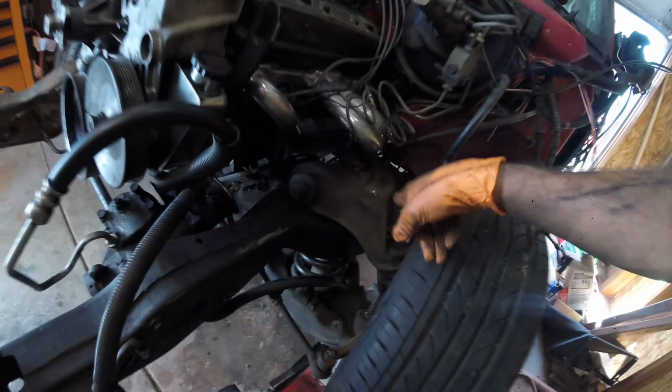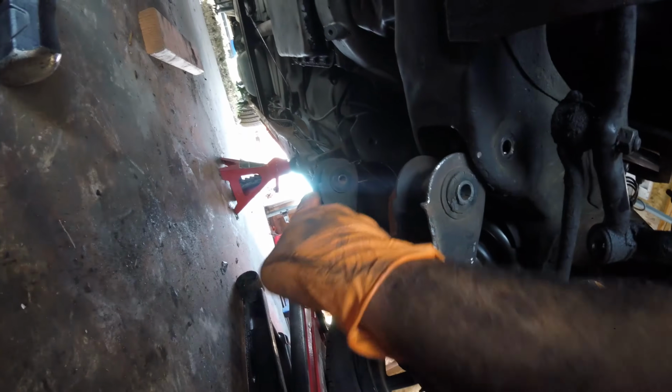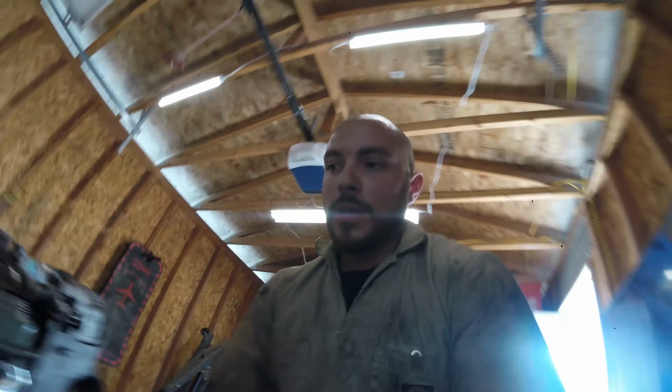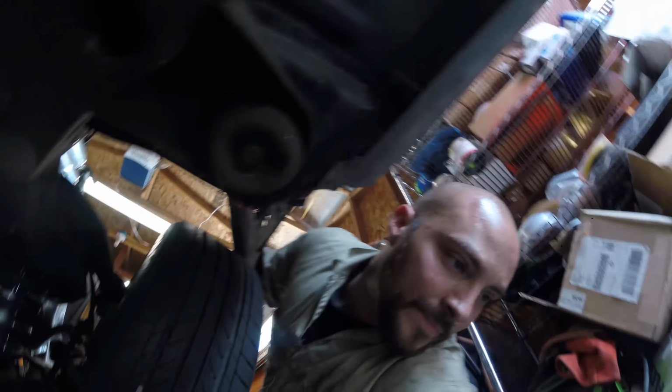Alright, it's closing time. I got the strut in, and then it uses a double nut feature. I'll keep it locked in, I assume. But I'm having an issue. I can't line up this control arm into the holes, so I might need to put a block under here and jack on this side. I need 2 jacks. Also, I'm going to look it up online, see what I can find out. But as for everything else, it's pretty good.